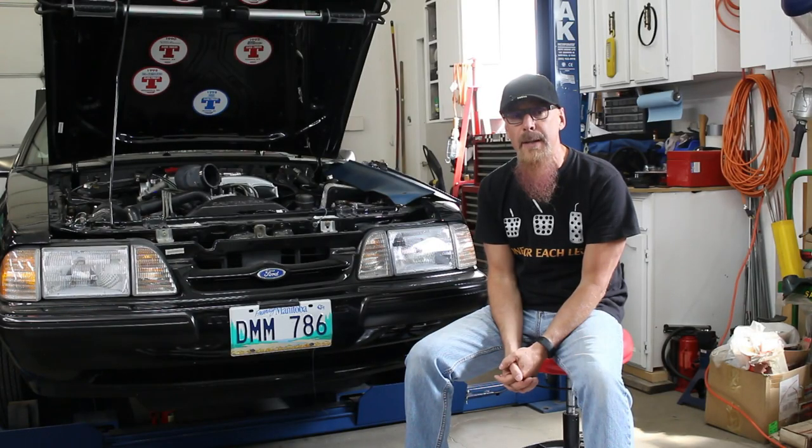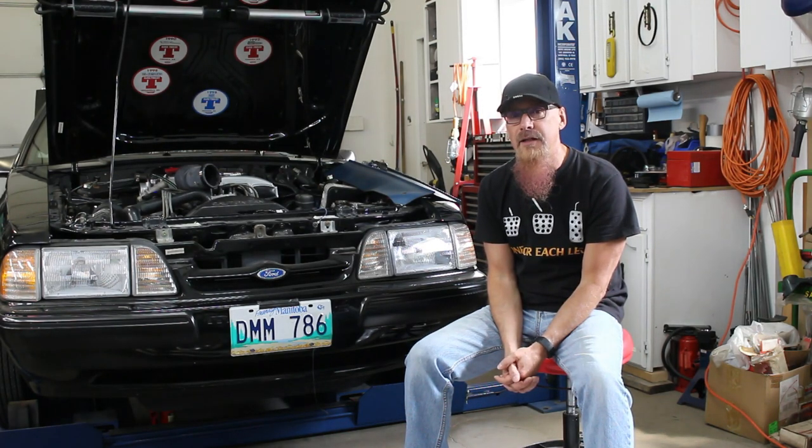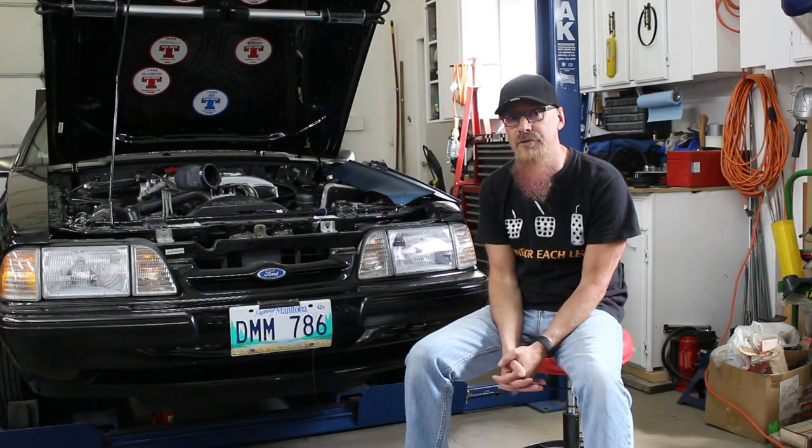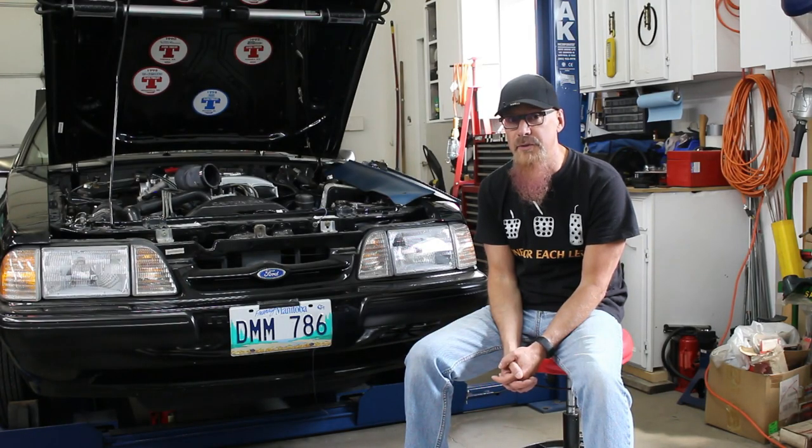Several days later now, and remember how I said that was like the easiest, smoothest header install ever? No. Headers went in, okay, but scatter shield, not so much. So my brand new headers, which are specifically designed for manual transmission, do not get along at all. In other words, no bueno, no fit, no possibility with my scatter shield. The headers went in because the scatter shield wasn't there, but with the headers in, you could not put the scatter shield in.